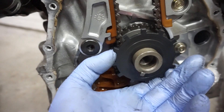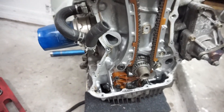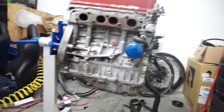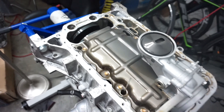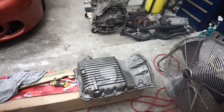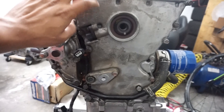This is what I need right here. On the F20, I didn't remove the oil pan to remove the timing chain cover, but on the F22 - the one that's going in the S2000 - I am going to remove the oil pan to make installation easier. Here's the oil pan removed on the AP2 engine, the F22.